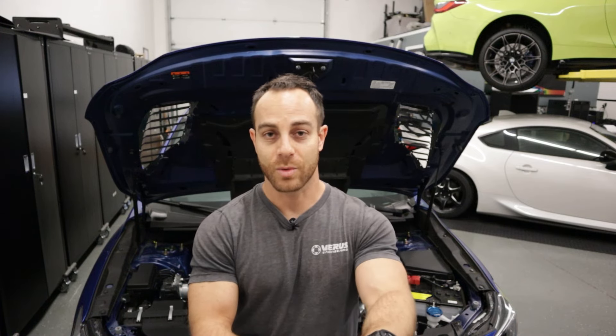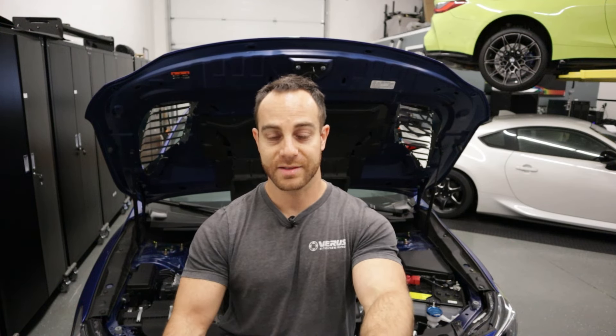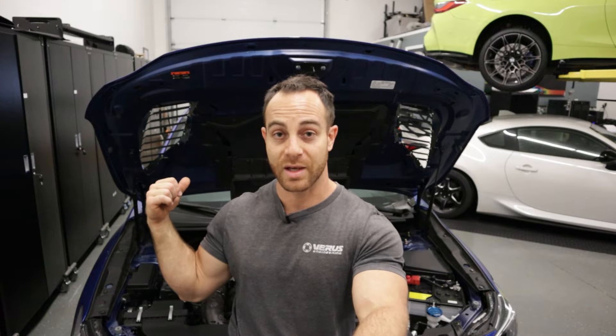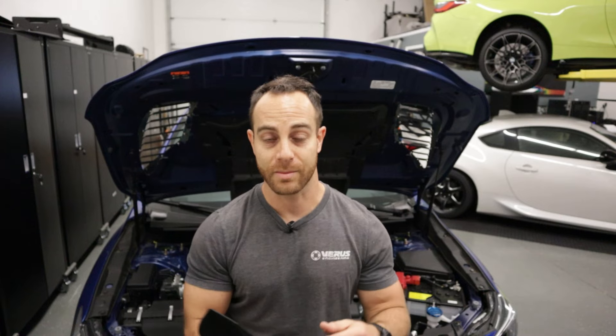Ultimately, high pressure air makes it a little bit harder for airflow to go through the cooling stack at the front of the vehicle. So when you throw a charge cooler in the front, you have that radiator, the condenser, maybe an oil cooler — it has a harder time making it through that cooling stack when there's higher pressure in the engine bay. So you want to alleviate or reduce the pressure in the engine bay, and that's what this is going to do, because we're not throwing air through a top mount intercooler anymore.